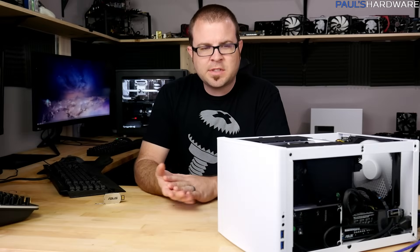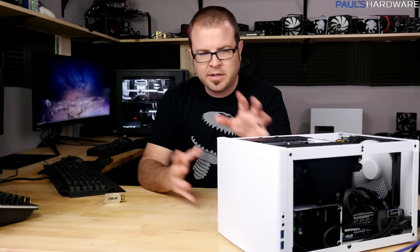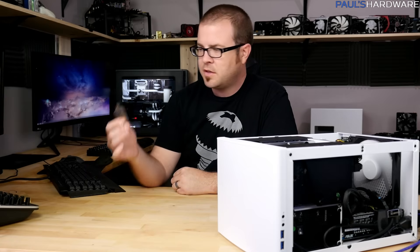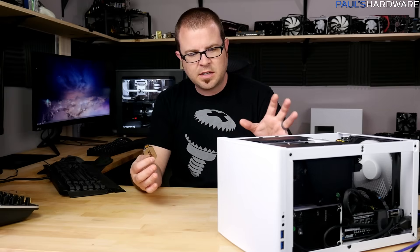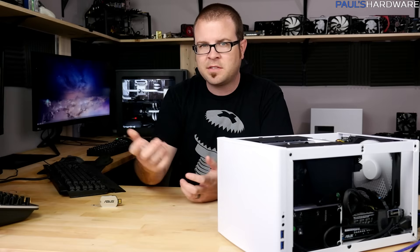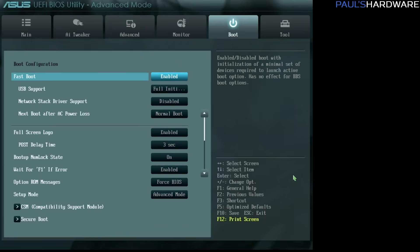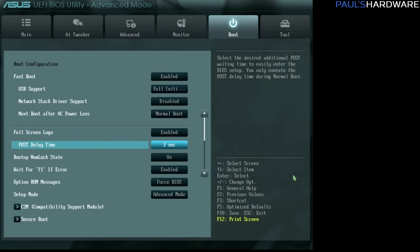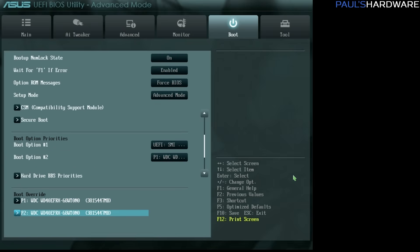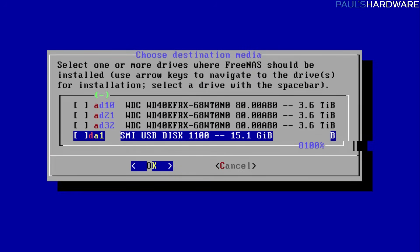Some time has passed, but I'm happy to say that with just a little work today and last night, I managed to get FreeNAS installed and it seems to be working just fine. I used the installer Logan set me up with. The main complication was that this motherboard had been used in a prior system, so I had to reset the CMOS, which cleared up any issues. Beyond that, it was no more complicated than installing Windows — switch the boot device to the installer, let it run, then switch boot back to the internally installed USB drive.